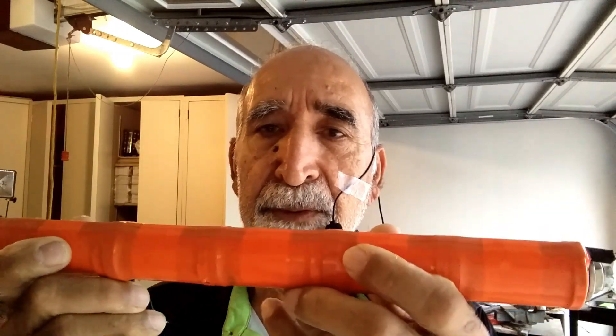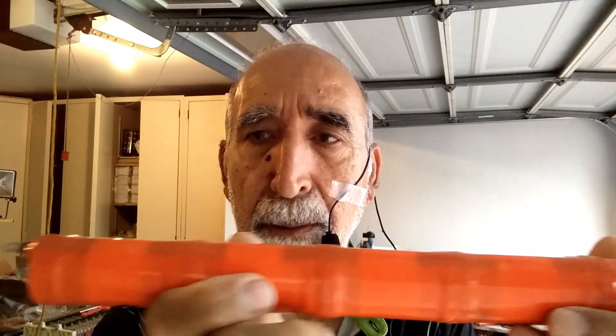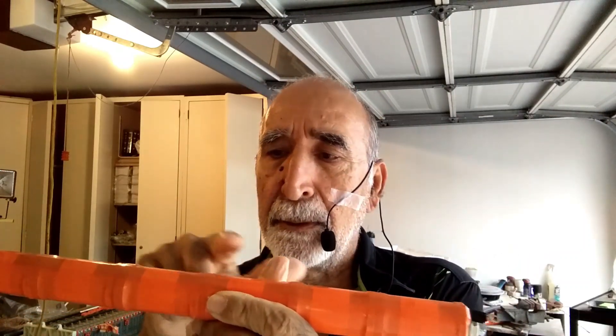The sticks are made of six D cells which have been welded together, and then they have these endpoint connectors. This is how they make one stick. There are a total of twenty sticks in the pack. Each D cell is about 1.2V nominal, so the stick's nominal voltage is 7.2V, and twenty sticks make it 144 volts.